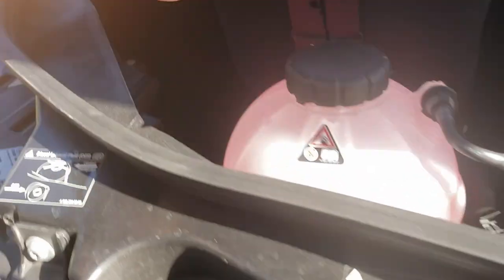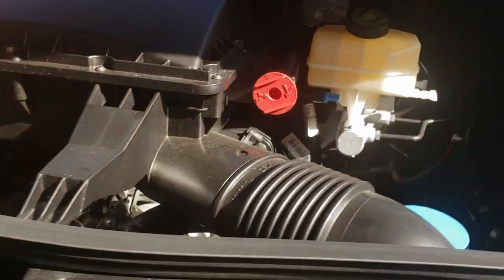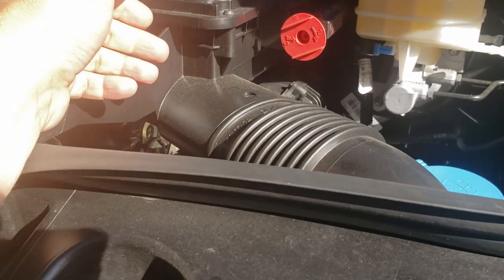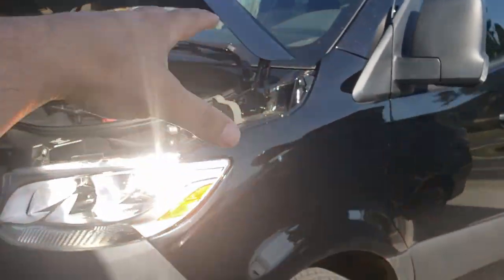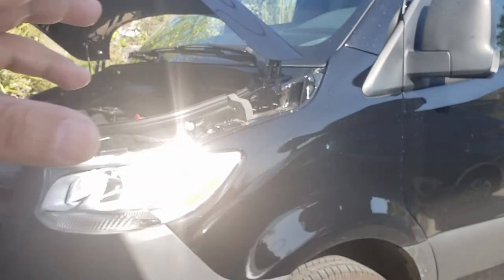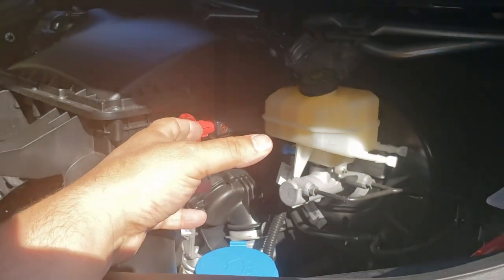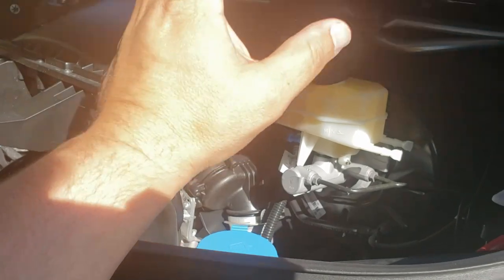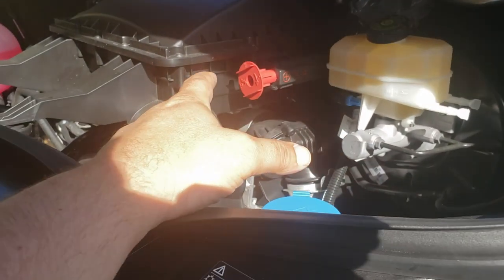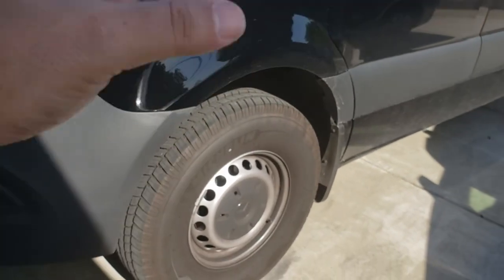Links for the battery tray, cheap tire carriers, and any goodies I've discovered will be down below. On diesel versus gasoline: you definitely want diesel, and the real reason isn't about horsepower — when you're dealing with something larger like this, look at the torque. A gasoline engine has to rev up to make torque; a diesel makes torque at the low end. It's just a lot easier to drive, and diesel motors hold better resale value.